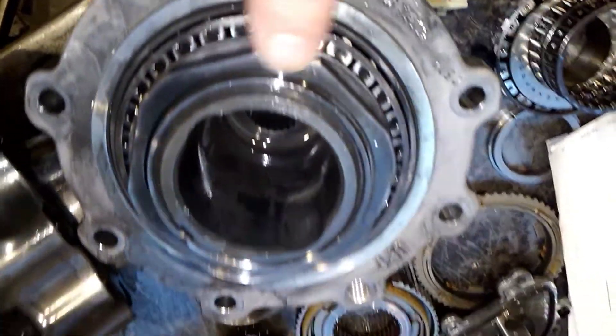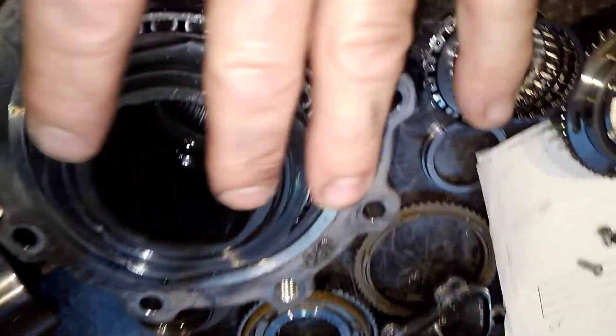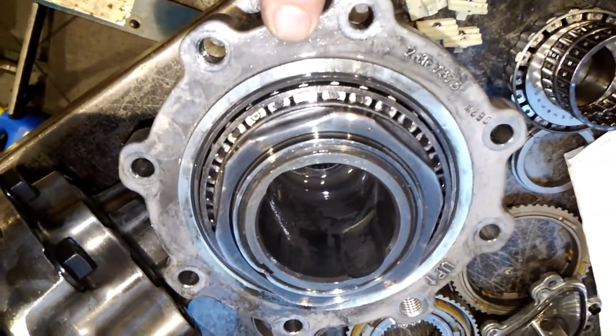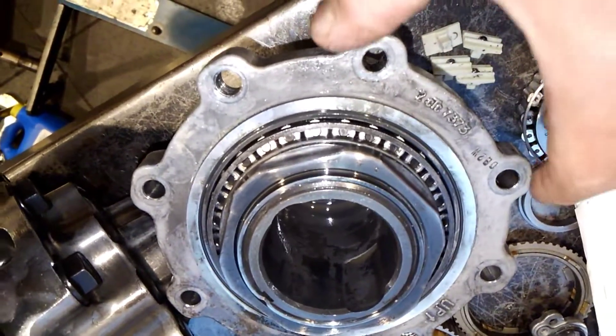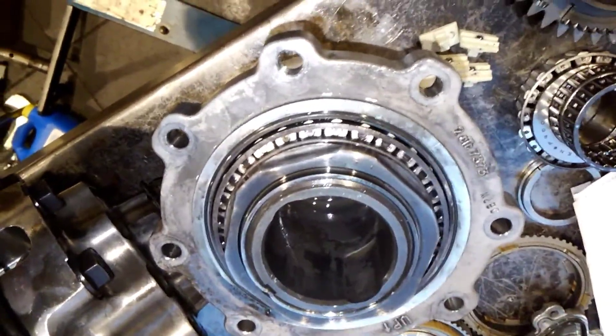This is your pinion, and you could see this pinion nut is extremely large, and it is also staked. The actual preload on this is extremely high - so high, in fact, that we are not authorized to replace these under General Motors' policy, because there's no tool nor any torque wrench to get as much torque as we need.